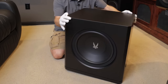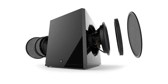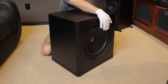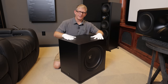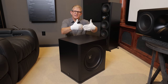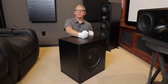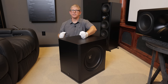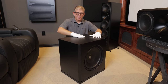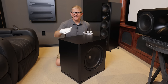This is a 13.8-inch driver on one side, but this is what they call a dual opposing subwoofer. If I flip it around, you'll see there's also another one on this side — these are going to be firing out. What's nice about that design is it really helps prevent the subwoofer from moving at all; they kind of cancel each other out as far as inertia is concerned. You could probably put a glass right on top while this thing is going nuts and it'll be super sturdy. They claim this is about the equivalent of a 21-inch driver because you've got two 13.8-inch drivers.